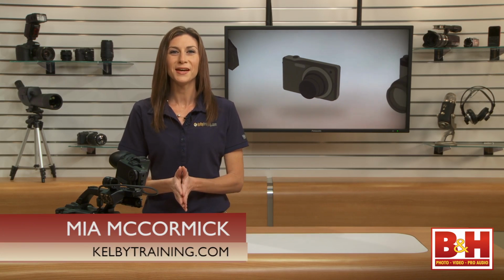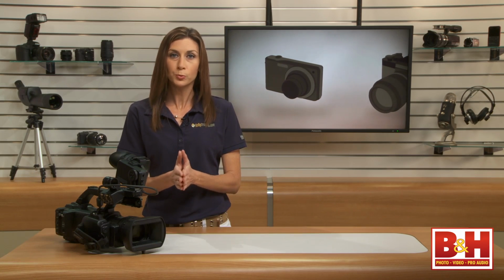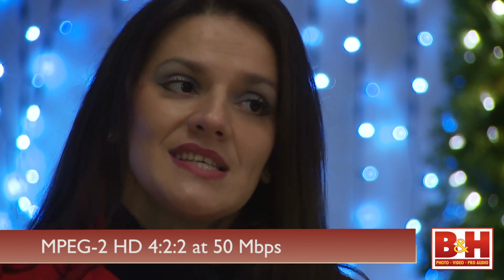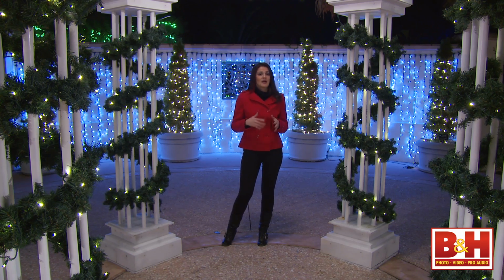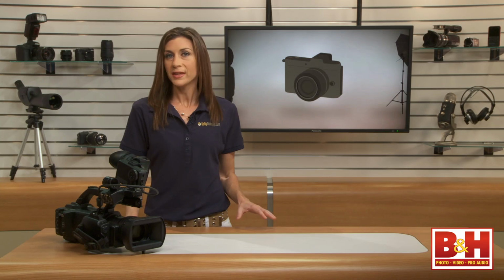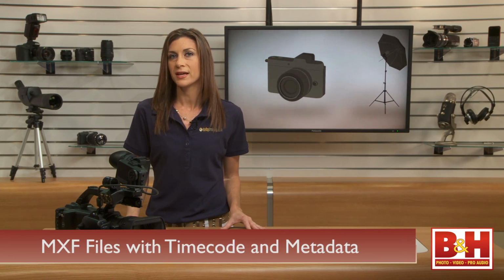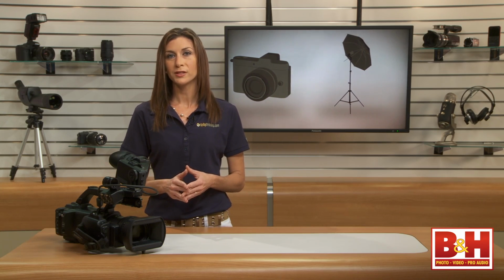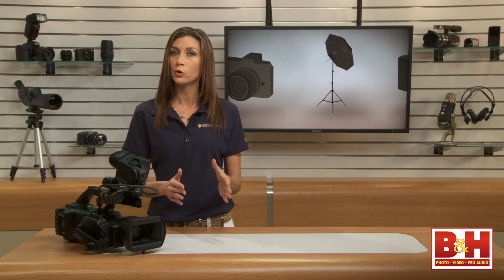Hi everyone, I'm Mia. The PMW-300 captures professional footage shooting a broadcast quality MPEG-2 HD 422 codec at 50 megabits per second. So it's capable of capturing a much less compressed video format than the EX3 did, and you should really see the difference if you're doing graphic-intensive post-production work, like working with a chroma key. The camera creates industry-standard MXF files, so you'll have full timecode and metadata support. The PMW-300 can also record HD with the lower 420 color sampling at 35 megabits per second.